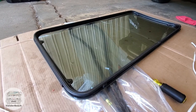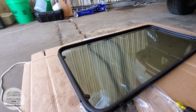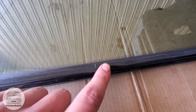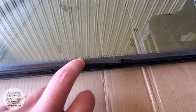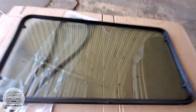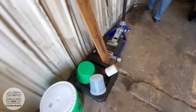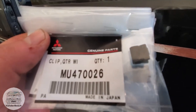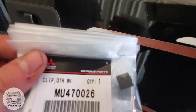It's the next day — the sealant hardened on both sides enough for me to lay it flat and apply that pad of tape on the other side. Try to be pretty straight with your lines because this is how much I have left when I overlap on the other side — you almost start to think there's no way you'll make it all the way around. Just try to streamline it and make it as straight and parallel as possible when you're going around. Now I'm gonna hold this up against the van and use the clips to attach the window to this lip — probably two on each side or something along those lines.